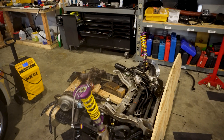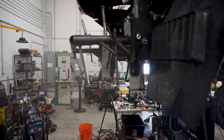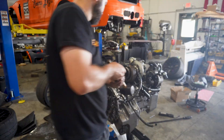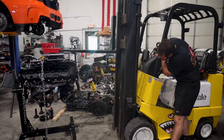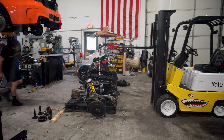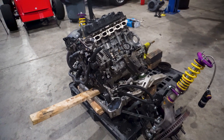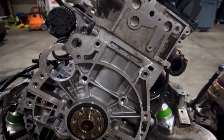Now it's the exciting stuff - we'll grab the turbo kit and slap it on while we have it on the engine stand. Then we'll take it off the engine stand and basically drop it onto my subframe, which is just chilling over here waiting. We'll plop that back in and deck the whole thing back up into the car. The only thing left now is we'll slap the transmission on the back, but before that I cannot forget to clean the oil galleys.